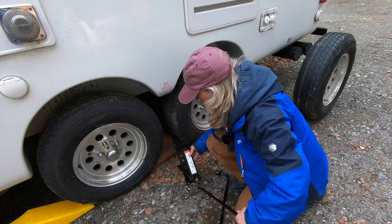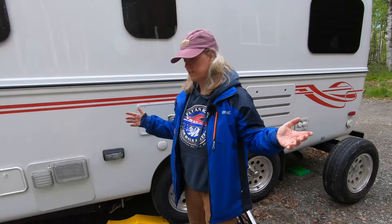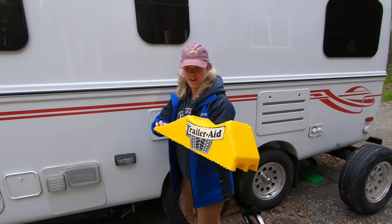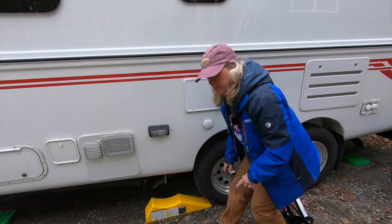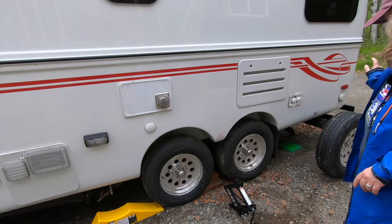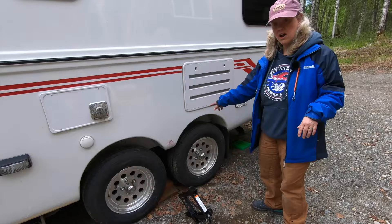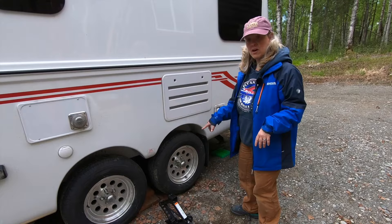There's one more way we can do this — method three, and this is the method you'll most likely want to use if you're hooked up to your vehicle and going down the road with a flat tire. What we like to use is this trailer aid. Basically what you're going to do is put this into place. Let's say it's your back tire that needs to be changed: you're going to have your spare ready to go, loosen up the lug nuts on the tire that needs to be changed, drive your front tire up onto the ramp, take the wheel off, put the new one back on, tighten down the lug nuts as much as you can, drive back off, and then tighten them with the torque wrench.